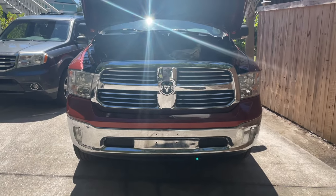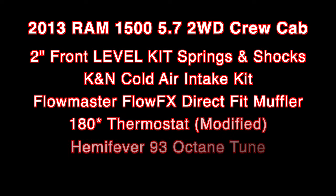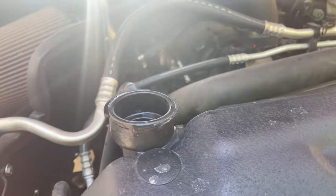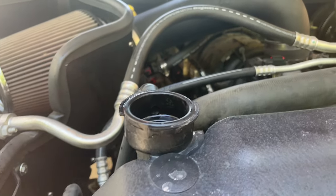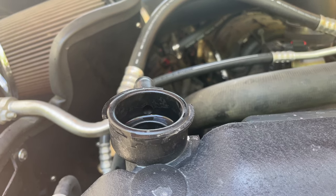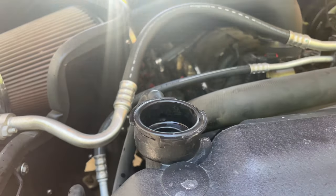We're doing some modifications on a 2013 Dodge Ram Hemi 5.7 1500 two-wheel drive. One of the modifications is a 180-degree thermostat. I was really fighting this truck getting air out of the system, and whenever I'd go out and make a run at wide open throttle, the temperature would begin to climb — even with the 180 thermostat — until I lifted. When I lifted, the temperature would spike to around 202-205, and I didn't like that. The whole idea of a 180-degree thermostat was to bring the motor temperatures down so it would be more favorable for timing and not have so much retard kicking in.